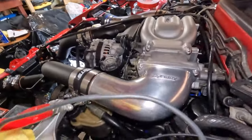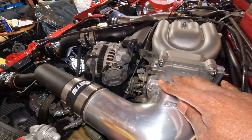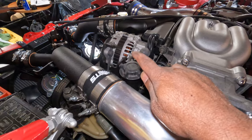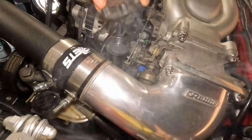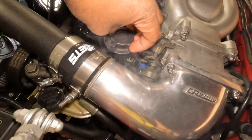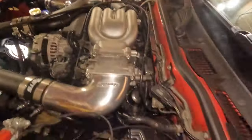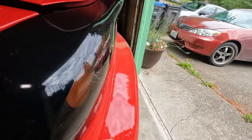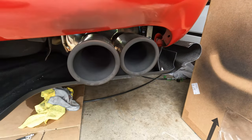Twenty minutes have gone by and I had a little scare because I saw some smoke coming from up under here. But I slowly traced it to my oil cap — check this out, the whole cap area is filled up with smoke. And I'm also going to show you something cool: it's coming out of the exhaust too. I'm going to go under the car to see if the exhaust flanges are tight and check if smoke's coming out of those.